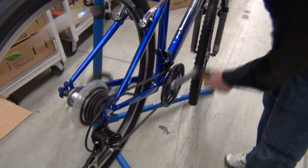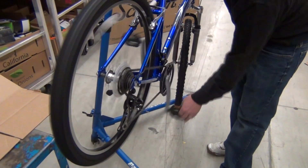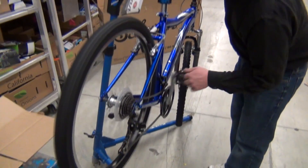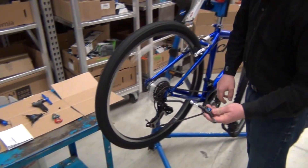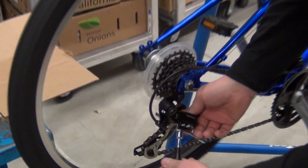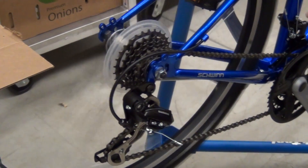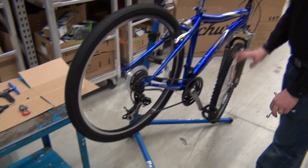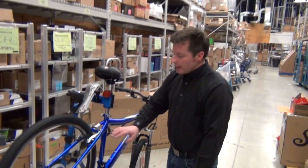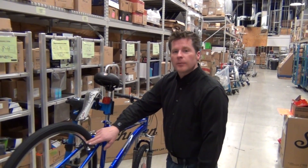At quick inspection, this bike is actually shifting quite cleanly and should be ready to go onto the sales floor. I'm just going to tighten up that pinch bolt using the box wrench again, so the cable is snug on the rear and the front - everything is in place. We've already talked about most of the bicycle, so we should be good to go, except for fine tuning this rear wheel, which we'll talk about in another second.